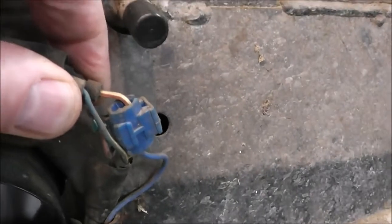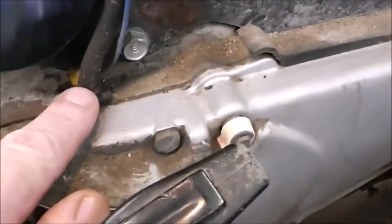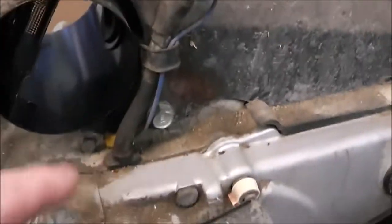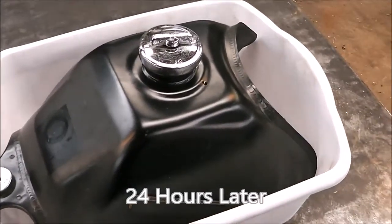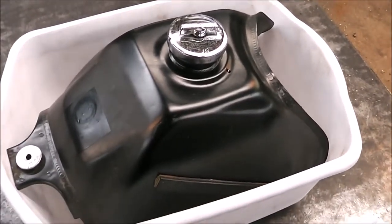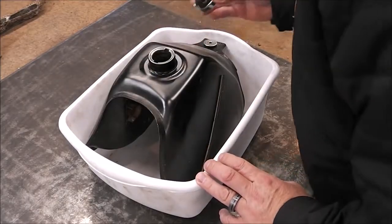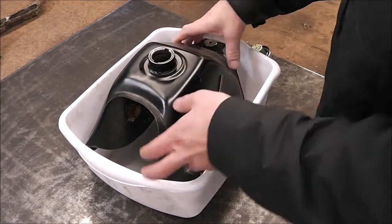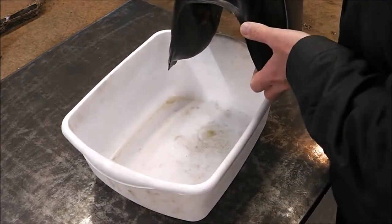If you've got one of these older Honda 86-87, that yellow wire with the red tracer coming out of this case right here — it's going down to that neutral safety switch inside, grounding it, bypasses it. Alright, you ready to dump it out? I'm real curious to see what this liquid looks like. Remember it used to be clear when we poured it in. I'm hoping it's going to be real dark because that means it removed a lot of rust. Yeah, I can already see that the liquid's a dark color inside. They say it's non-toxic so I'm not going to sweat wearing gloves.